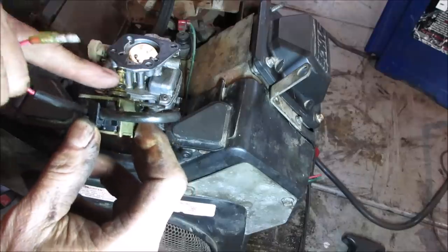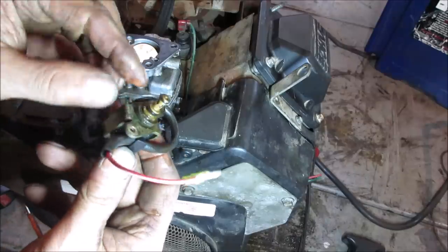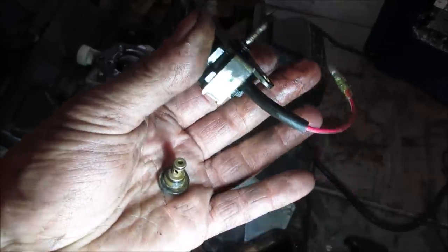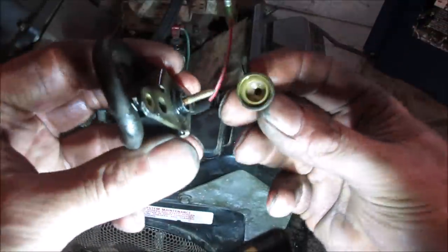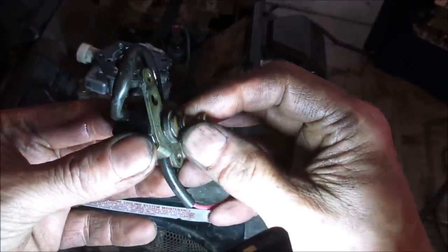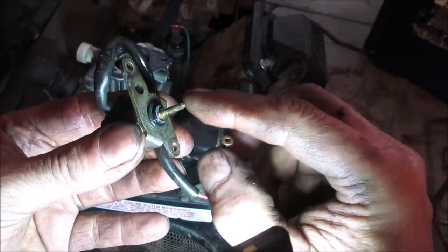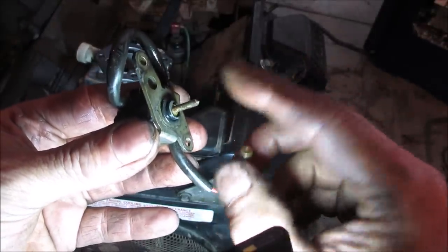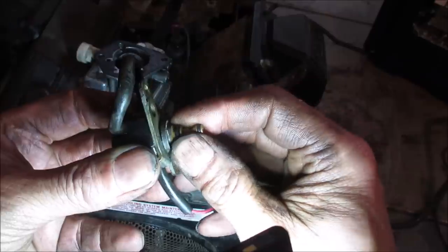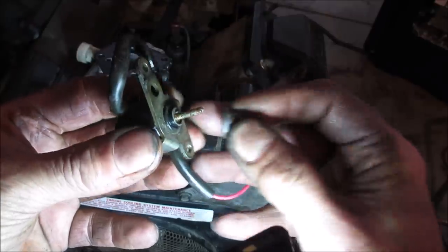And it probably goes, fuel goes through here and out there, or vice versa. I pulled the guts right out of it. Well, that's supposed to open and close that circuit, and she was stuck. Again, it's the electric part that pulls in when you energize it, opens it up and lets the passage go through. And it just went boom, and it popped off.